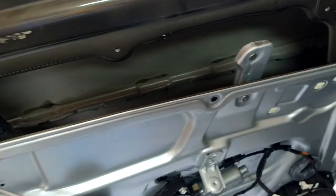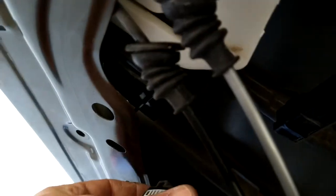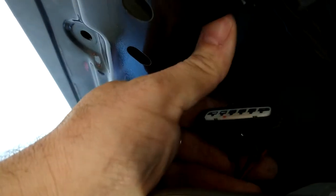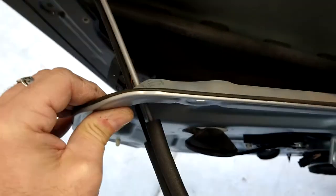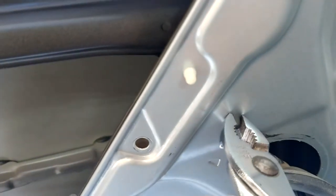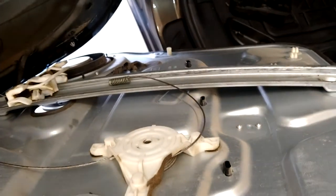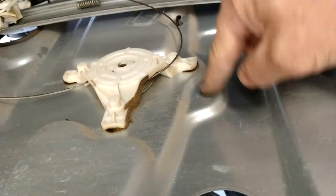Pry the front down until that clears under the silver, then you're going to have to reach in here and pop this off — push these and pull — it'll release. You got that free and you can see how those cables come through here. To get these little clips out which hold the wires, I'm just going to use pliers, pinch them, push them out — just like that, it's real easy. The other ones on the back are a different style — same thing. If you pry from the front you're just going to break them.